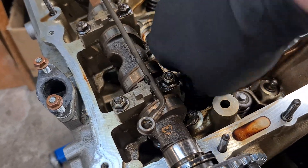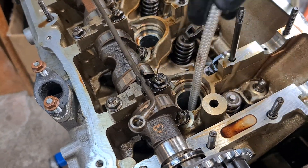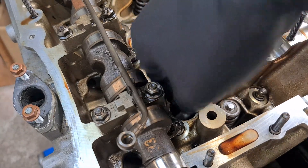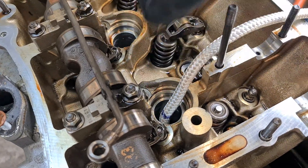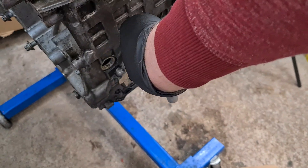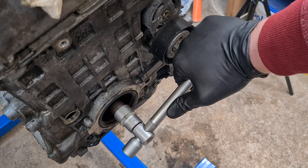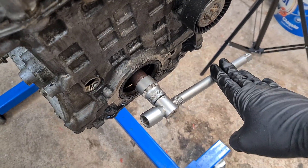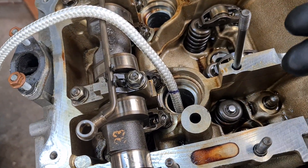Let's start — in it goes, just cram it in. You should feel when it kind of starts to bundle up inside. So this is our 70 centimeter mark and this should be enough. Now I'm going to slowly rotate the crankshaft clockwise until I feel resistance building up — do that slowly and you should feel when it starts to bind. Now the rope is pressing against all of the valves in this cylinder.